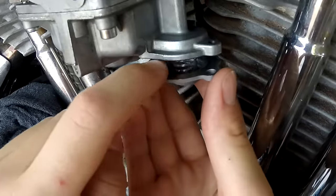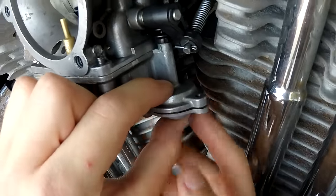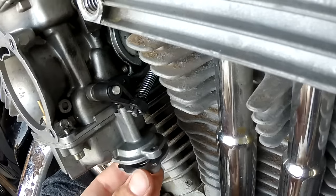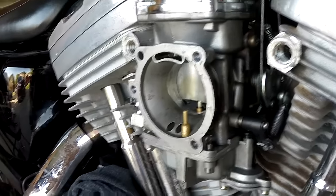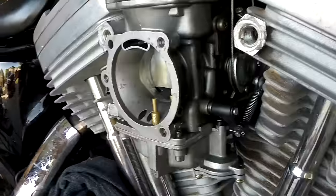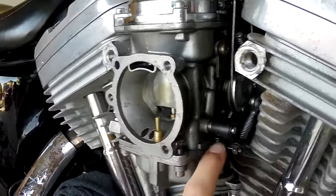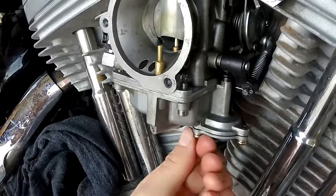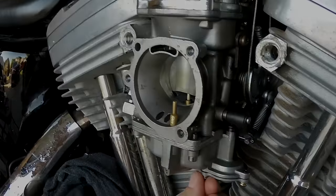You want to make sure that it seats into the diaphragm. You're just going to hold that in place and then put your three little screws back. Be very careful not to strip those screws, because I can only imagine it's going to be a huge pain to get a stripped screw out or find a new one. This is a really simple fix — save yourself the hundred bucks taking it to a shop. Rebuild kit, put on a new diaphragm, especially if it's torn. That's most likely going to be the cause if it's leaking out of the top of that little boot. Tighten these up, test it out, start up the bike, put the air filter and everything back on, and hopefully it won't leak any more gas.